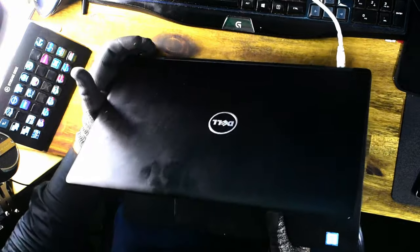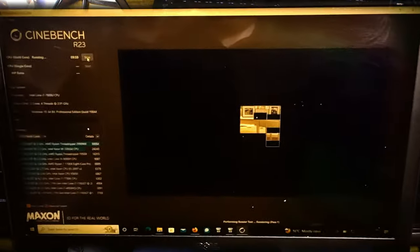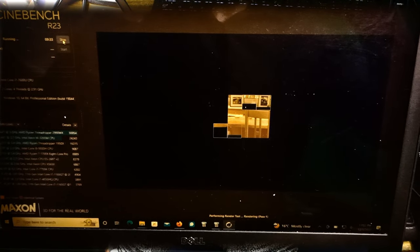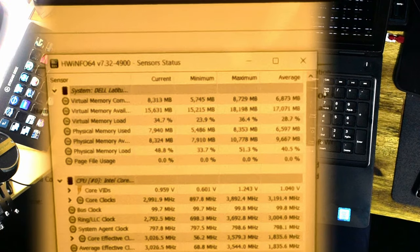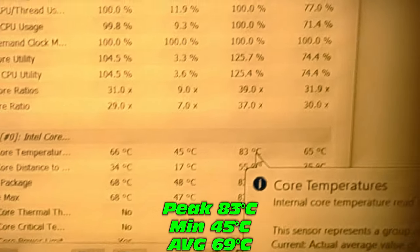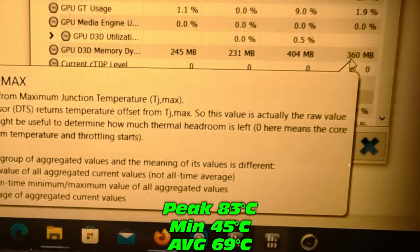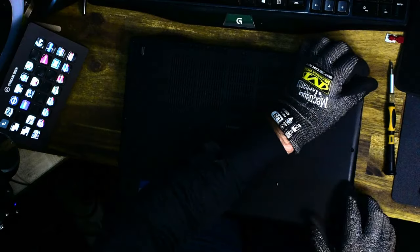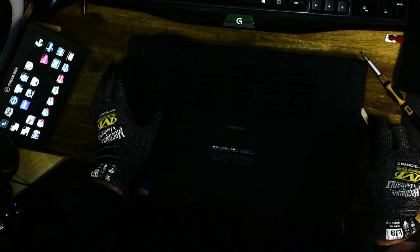We want to see if there's actually something wrong — and there is. Let's stress it with Cinebench R23. Right now rendering a rather complicated image on the CPU, those cores working very hard. Checking temperature: 66 degrees and a peak of 83 degrees Celsius, which is relatively warm. Minimum was 45 and average around 69 degrees Celsius. That's a definite cause for concern — let's dig a bit deeper.